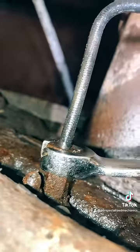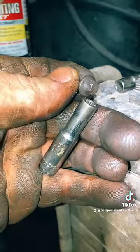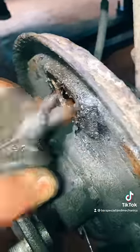The way to remove this: unbolt your wheel cylinder so she's free from your backer plate. A six-millimeter six-point or a quarter-inch 12-point work good for these wheel cylinder bolts — we've got a six-point head on them. Pull your cylinder out along with that brake line.